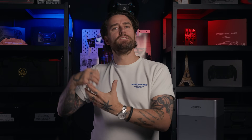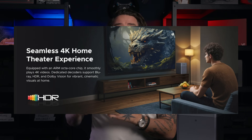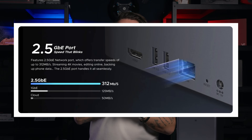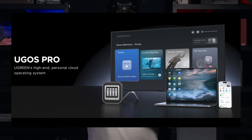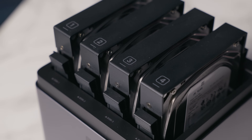There are a few things you need to consider. It is still an ARM NAS, meaning no heavy virtual machines. For 1080p and 4K streaming at home, it's perfect — you can stream to your phone easily. Just don't expect it to be a full-blown server farm. It only has a 2.5 gigabit ethernet port, so no link aggregation or failover. For most home and small studios, that's not a big deal, but if you want dual NIC setups, you'll need to look at the higher-end DXP line from Ugreen. The app ecosystem is still growing — UGOS has the essentials: backups, multimedia, Docker, snapshots — but it's not as mature as Synology DSM or QNAP. If you live inside super niche apps, check compatibility first.